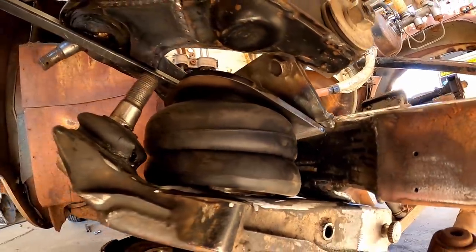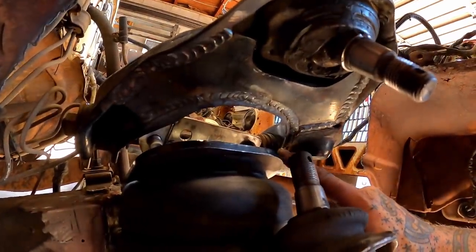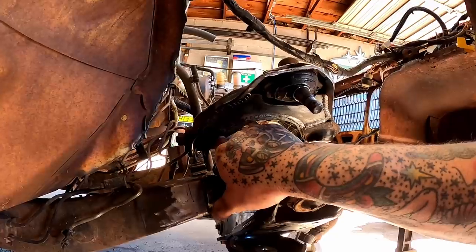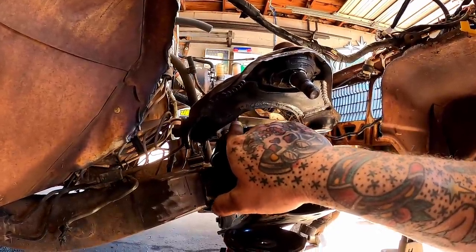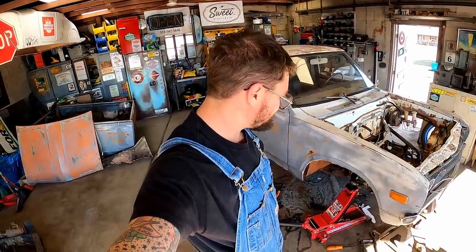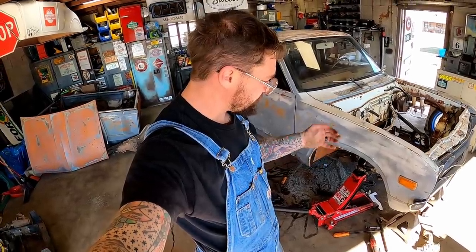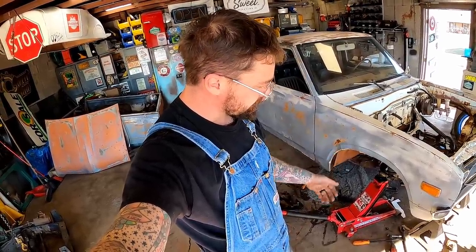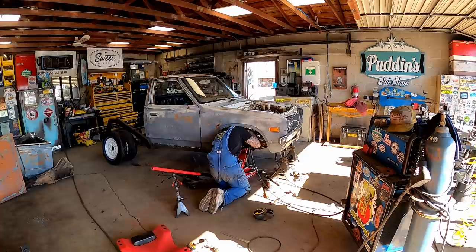We're sitting good clearance-wise. I think with a little grinding, we can clear the front control arm here, but now we're gonna hit on the back. I think we can trim off that lip right there and maybe we can work it. We may have to work that plate too. Tight, tight, tight fit, guys. So I need to tack that plate where I want it. Just pry down on it, tack it, then start trimming that control arm and whatnot. We'll see what happens here.